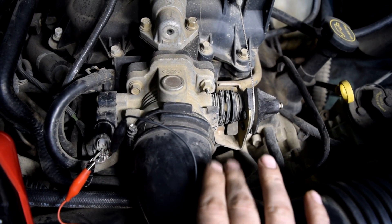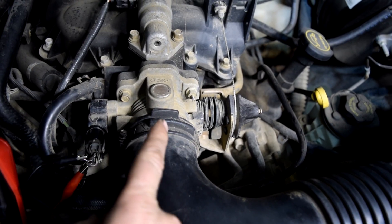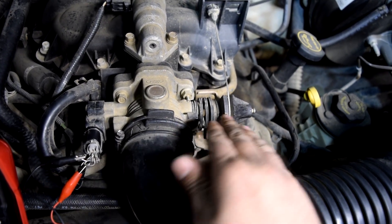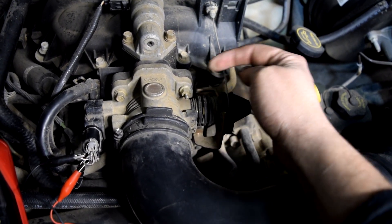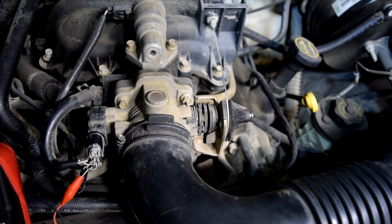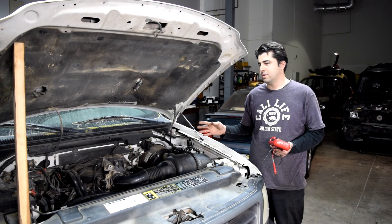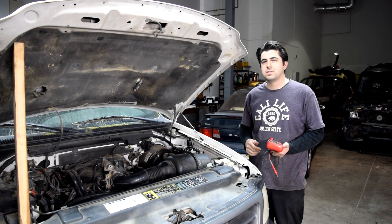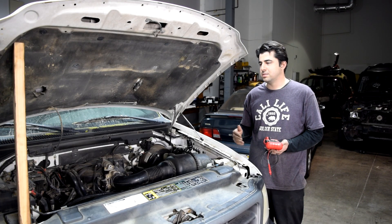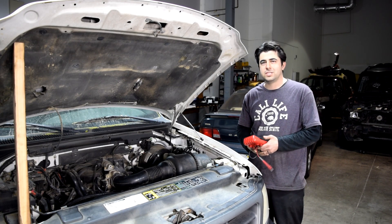Also, more important than everything else, get the intake tube off and inspect around your throttle plate inside your throttle body. Carbon buildup can sometimes keep your throttle plate open a little bit and get in the way of the shaft moving freely, causing binding and throwing off your voltage output from your throttle position sensor. With that said, if you found this testing procedure helpful, please give this video a thumbs up and check out some of my other videos where I use this multimeter to test other sensors and components. Thanks for watching — see you next time.